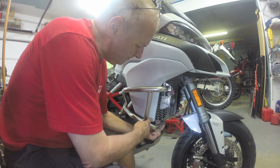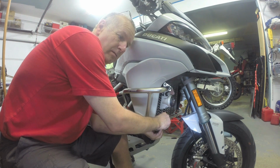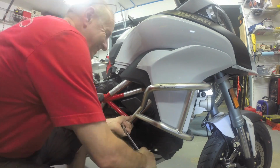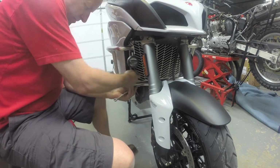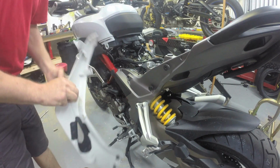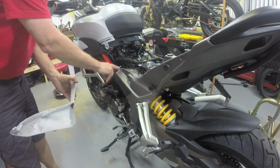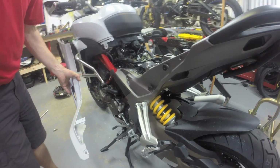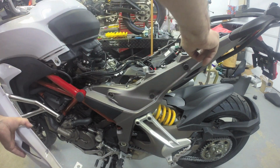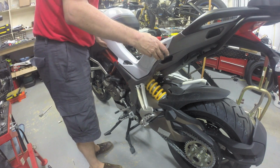Is that one? Bolt goes in the crash bars. We've got two mounts here, which these two have to slip over, and then there's this kind of stud here that this loop has to fit over. We've got two prongs that are going to sit up inside of here, and then finally 3 screws with plastic washers hold everything on. So it's got to slip on from the back. It's all a bit trial and error for my part because I've not done this before, but I'm over those two.